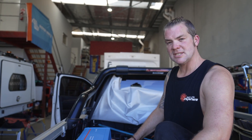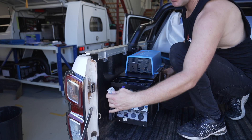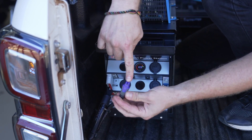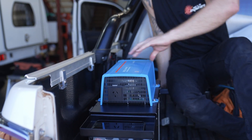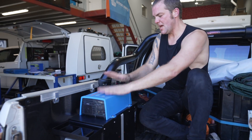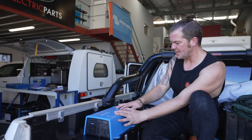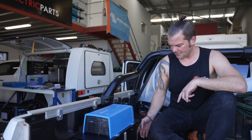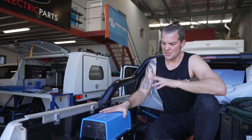The next time you want your dual battery system installed again, you unplug the charge cable and the supply cable for the relay hub, then plug it back into the front. This is an ignition trigger cable because this is an Isuzu D-Max, which needs an ignition trigger for the DC-DC charger due to its smart alternator. You plug the charge cable back into the back, and now your battery box slash power station is running the relay hub again. All your appliances run off the battery, and your dual battery system is reinstalled.